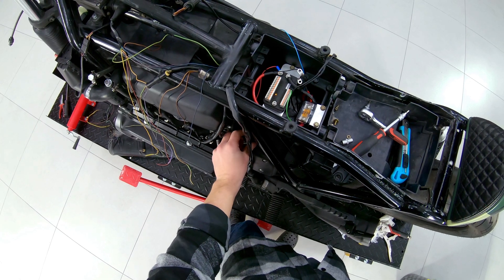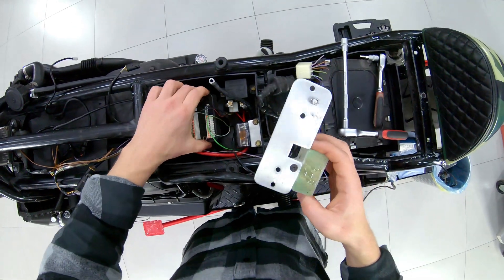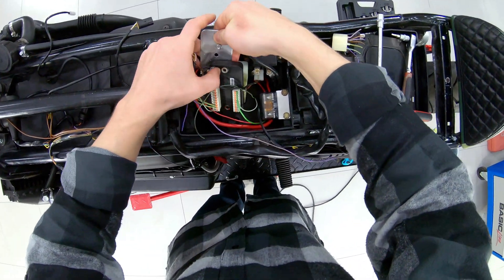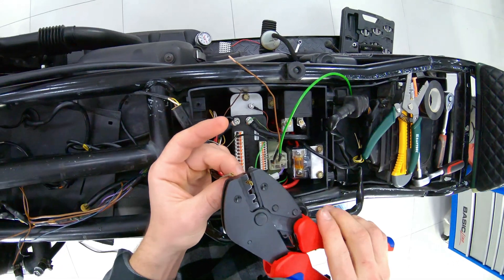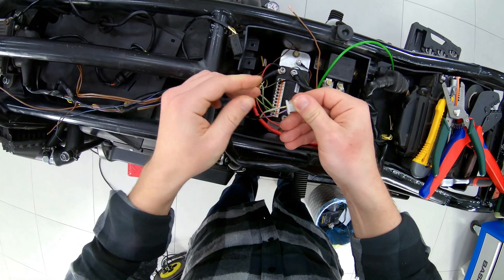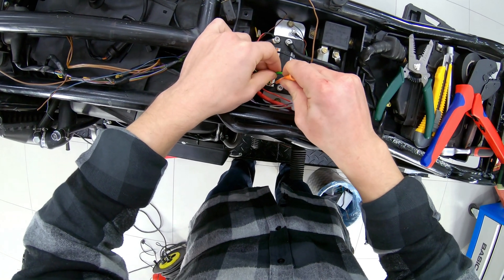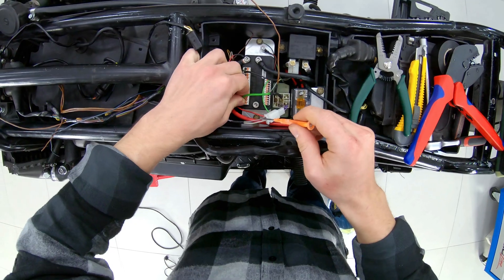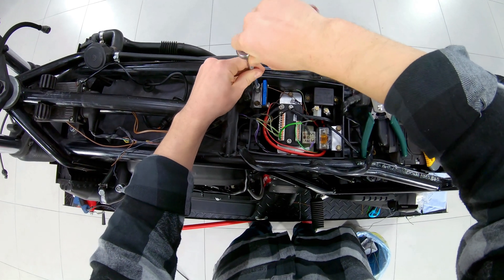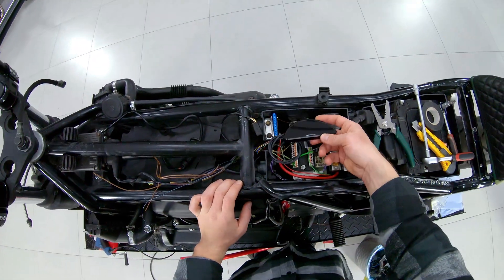The M-Unit is connected and working. The OEM starter relay remains. I modified the plate and fixed the temperature relay on it, which controls the radiator fan. I connect the fan via connector and temporarily plug the relay into the auxiliary output. The Breakout Box is mounted to the left of the M-Unit in only three corners. This box combines all signals, except for the speed sensor and tachometer, for transmission over one wire to the Motoscope Pro.